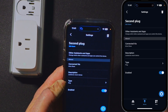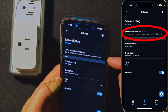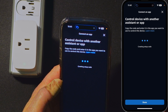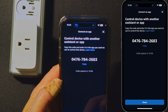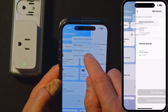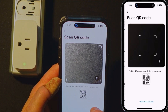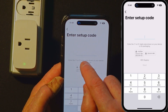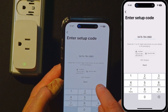At this point, we want to go into Settings and select this option — Other Assistants and Apps. So we're going to add this to the SmartThings app. To do that, we need to generate a setup code, which we copy. Now let's go over to the SmartThings app, hit Add a Device. So we'll select Partner Devices, and then we'll select Matter. Then we're going to add without a QR code — that's a selection at the bottom here. We'll paste that Matter code in here and hit Next.